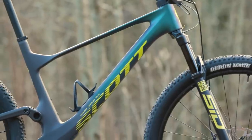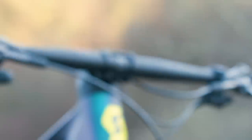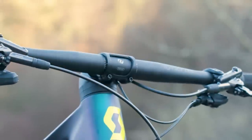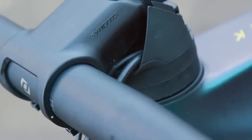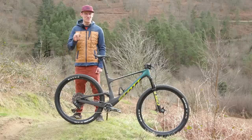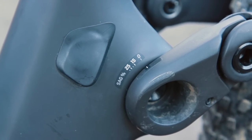With no shock complicating the inside of the front triangle, a pair of bottle cages are easy to locate. Brake hoses are run neatly through a shrouded stem and into the headset for even cleaner lines. Setting up the Spark was incredibly easy, even though the shock isn't visible — there's a small sag dial on the linkage which is visible from the bike.